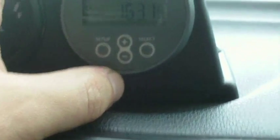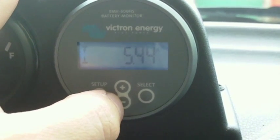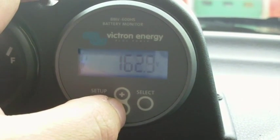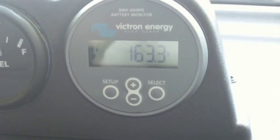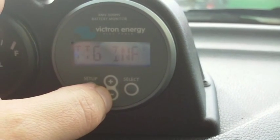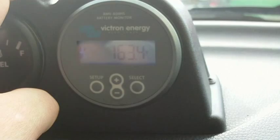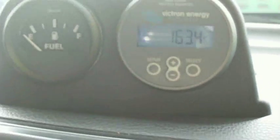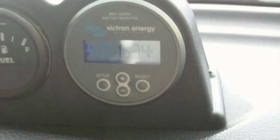We're now down to 6.5 amps AC, and there's our voltage dropping back down again. We're now charging at 5.44 amps with 2.2 amp hours to go. We're at 163.3 volts, 5.3 amps charge, full pack — and that's about it folks. 163.4 volts, it's coming up to the end of charge. That's a full control charge with the capacitive charger without any trouble.